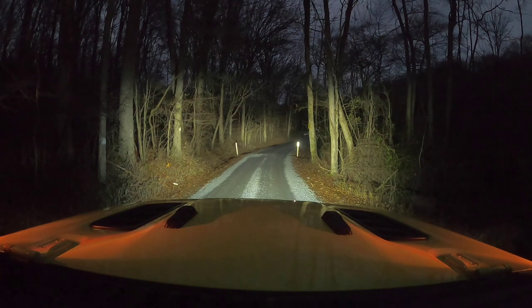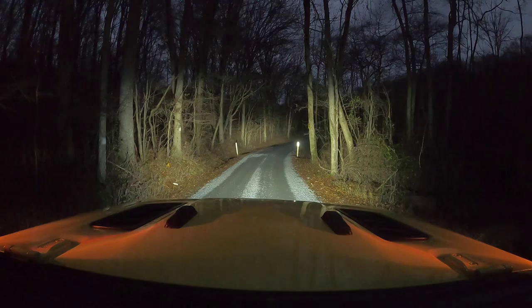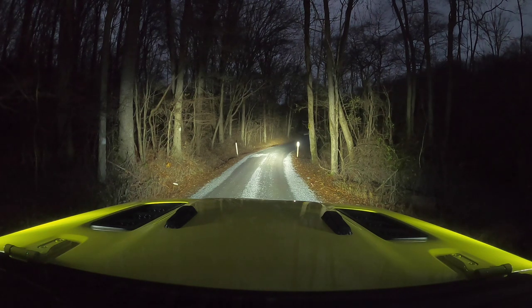We've got the GoPro flipped around. We're going to show you from start to finish: ambers on, then the front crosslink bar - what a light output - and then the spotlights. I want to adjust them a little bit higher up and I'm going to hop out and do that. You kind of want to do this on a back road or dirt road. The reason I mounted them up on the pillars is so when you turn them on, it doesn't reflect like crazy back off the hood onto you. A flood pattern will shoot super wide, reflect off the hood, and could be a safety issue in winter. Spot keeps it more pencil tight and shoots it a lot further forward.